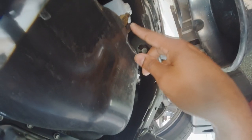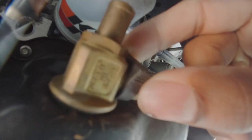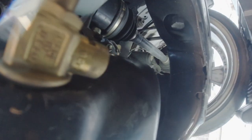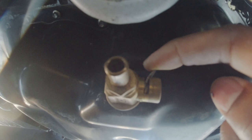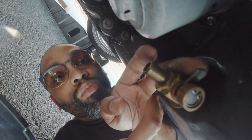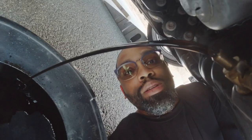I have a Fumoto drain valve and I'll put a link in the description below where you can click and buy it on Amazon. So with this you have a little safety cap that keeps the valve from accidentally opening — put that somewhere where you can find it. There's a lever here that is spring loaded, and the way mine is positioned, you kick the lever to the passenger side and then twist it back and the oil flows out. Make sure your oil pan is lined up, push it towards the bottom of the car, and the oil flows out just like so.